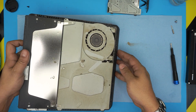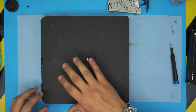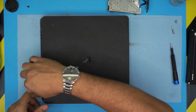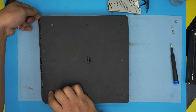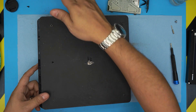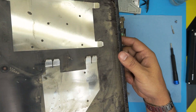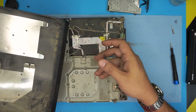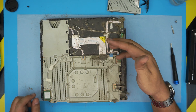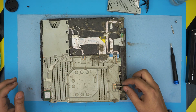We're gonna take it upside down and shake it out. To remove the bottom cover, it's the other way around — remove from the back side where the hard drive is. Put your edge on the corner, lift it up firmly, bring it up a little bit, then slide it towards the front end of the console. Holy Jesus — there's the bottom case, full of dust.